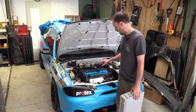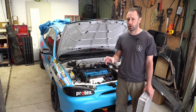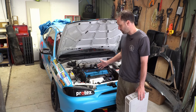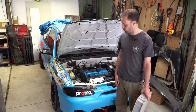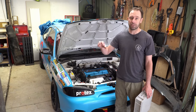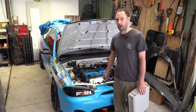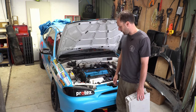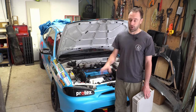Now, while we're at it, just a real quick note on coolant. Something that's a bit weird with Motorsport Australia is, in the rules, it allows you to run whatever coolant you want. A lot of people run glycol-style coolant, which is really slippery. I think this should actually be a rule change for Motorsport Australia — I don't know why they allow it. If somebody blows a radiator, it basically puts slippery stuff all over the track, and if you're leaking, that goes down under your back wheels. I think it's a really dumb thing that that isn't banned. My old man used to race sidecars in Europe back in the 70s and 80s, and it was banned back then — you were only allowed to run water in your radiator, which I think is how it should be. So I don't actually run glycol. I run Redline Water Wetter, which is a different type of formula.